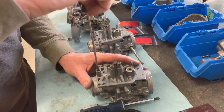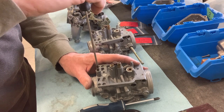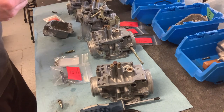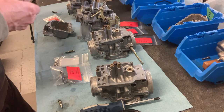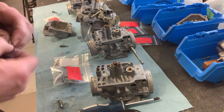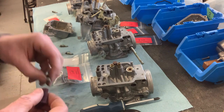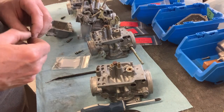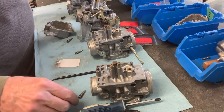There's a half, there's one, there's one and a half, there's two, there's two and a half. Next I'm going to do the O-rings on the drain plugs — just cleaning the tips of these with a bit of carb cleaner and the Scotch-Brite pad, and they can go back in the float bowls. All the new O-rings are on, I did not drop any, so wonders never cease.